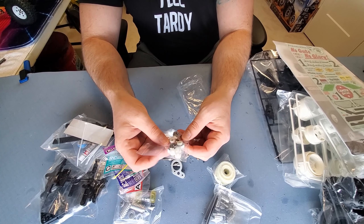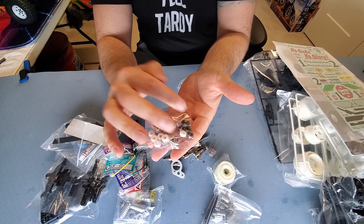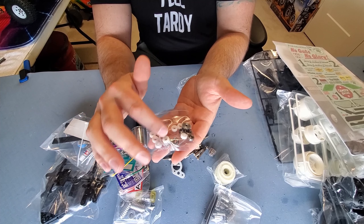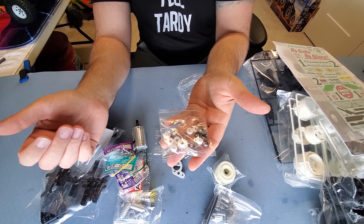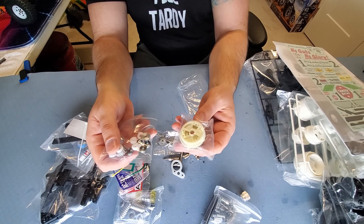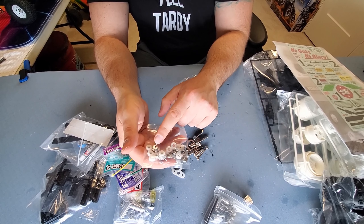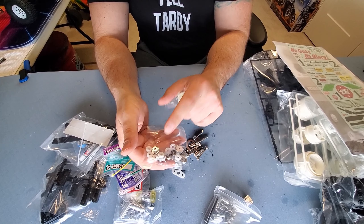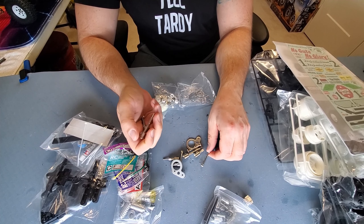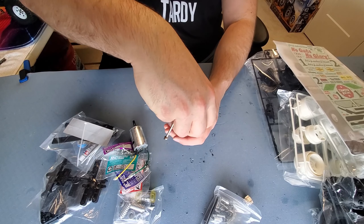We've got a variety of pinion gears — three different pinion gears — and this kit has multiple gearing options. Three different pinion gears and three different size spur gears. The bigger the pinion, the more top speed you have. Smaller pinion means less top speed but more acceleration. Nice thick metal front uprights, dog bones, output shafts — all sorts of nice metal bits and pieces.